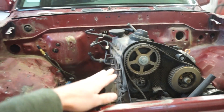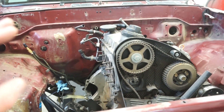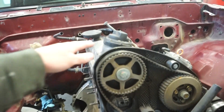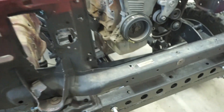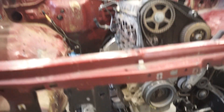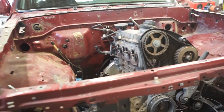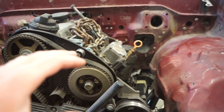I took a bunch of measurements on height. This motor has to stay in the same spot — it's very, very tight to the hood. And also when the steering is all on, it's pretty close to the pan. So it's got to stay in the same spot. That's why I'm going to take the extra precaution and just do one side at a time while the other side is still bolted on.